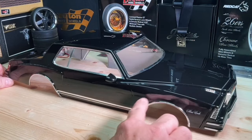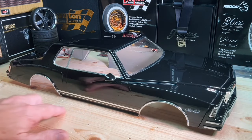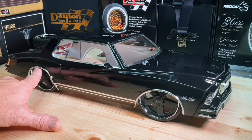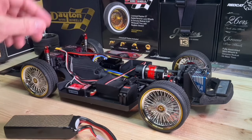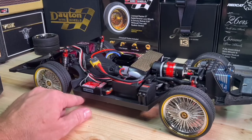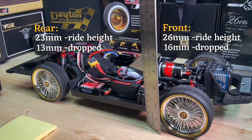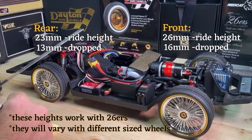There's only so much room for the wheel to tuck up into the car, and I want to get the car down on the ground as much as I can. With a factory wheel it just sits right on the ground — not the same kind of clearance area — and this wheel also hits up in the fender, so this is about as low as you're going to get. Before I disconnect all the horns, I need to take measurements. With it turned on and set to ride height, the measurement is 26 millimeters in the front and 23 millimeters in the rear.